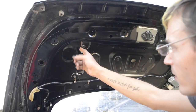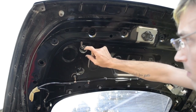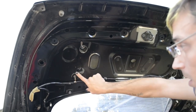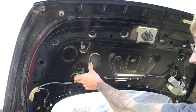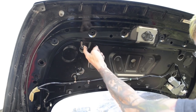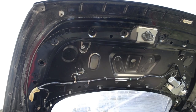There are a handful of things you can do with these holes. I have one-and-a-half-inch grommets on order — they'll just pop in there so I don't have to worry about surfacing and painting them. If you have a steel deck lid, I would go ahead and at least prime them so you don't have to worry about rust. Just put any kind of rust blocker on it — Rust-Oleum or any kind of primer.